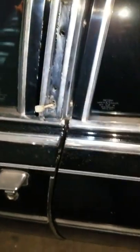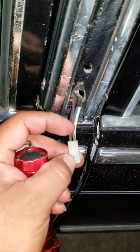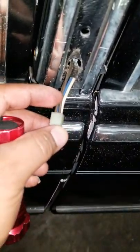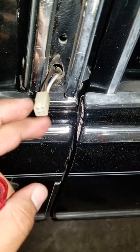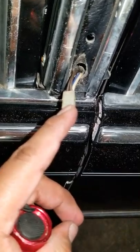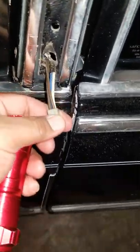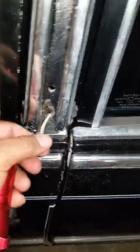I've tested it for power and I only got current out of the two brown wires — the top two. The left-hand side appears to be negative and the right positive. When I tested them one way I got almost 12 volts, and when I flipped it it read negative. But I didn't get any reading out of the blue or white wire.